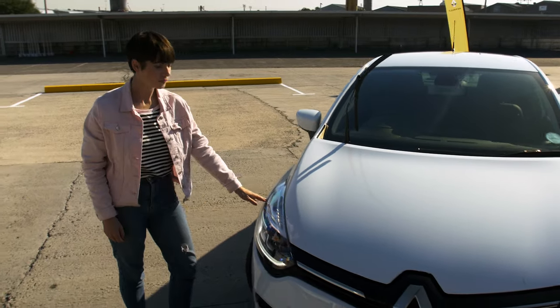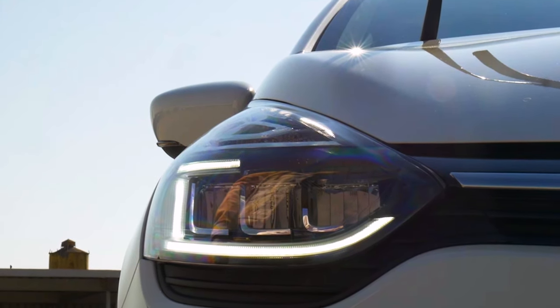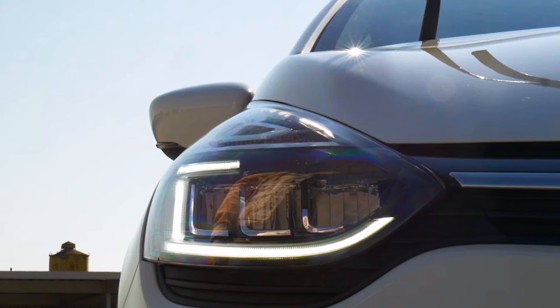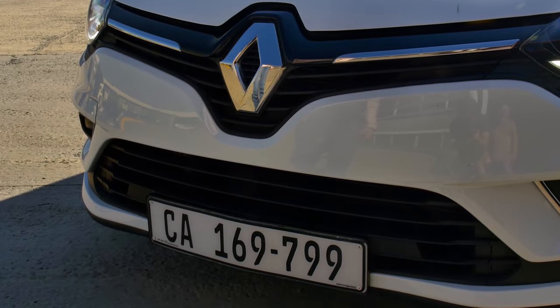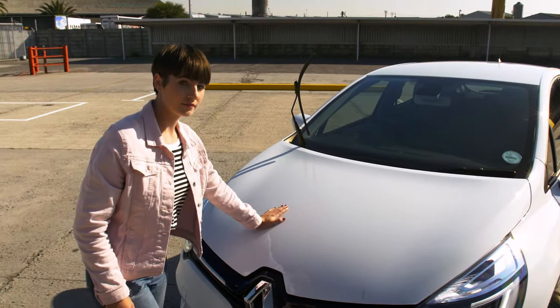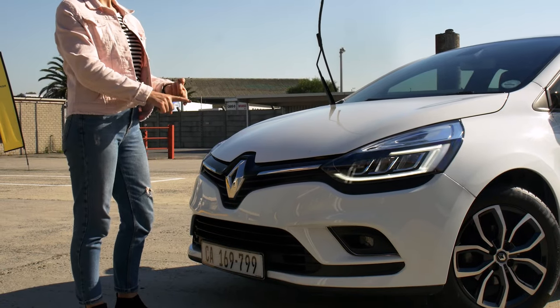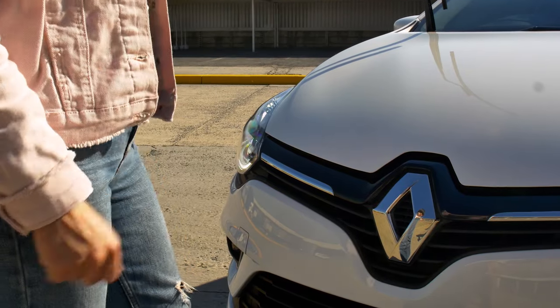Point to the front right-hand light and reflector cluster and say that the lenses and reflectors are not dirty or broken. Confirm that the front of the vehicle is not damaged and that the bonnet, grille and bumper are secure. Indicate to the examiner that you have checked under the bonnet for oil, water and brake fluid and inspected the condition of all visible engine belts.